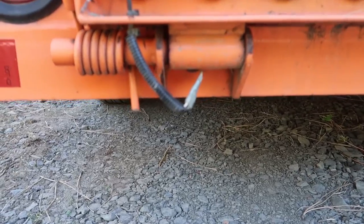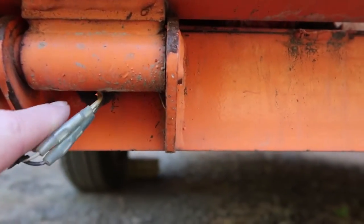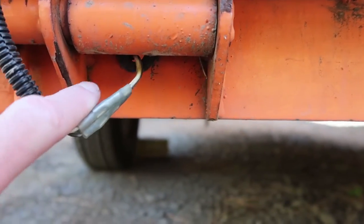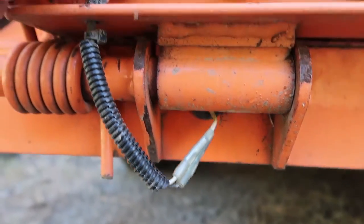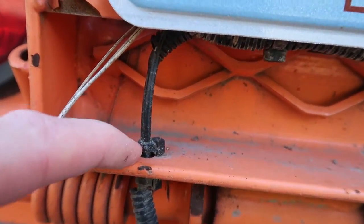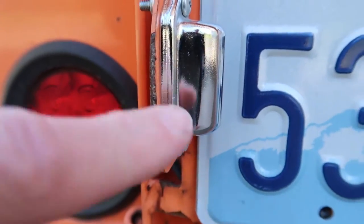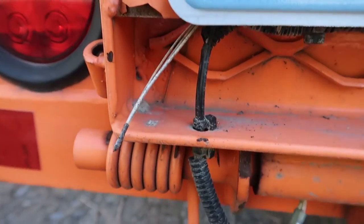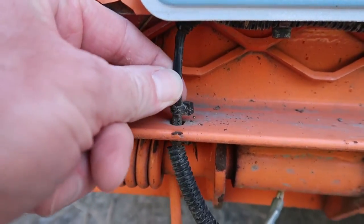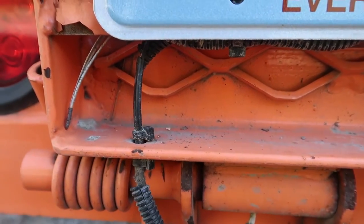And number five is how they've got the license plate light wired up. There's a little tiny hole back here through the frame, the wire goes through the frame — there's actually a little rubber grommet there — then it comes down and goes up through another little tiny hole. I've actually replaced that license plate light. The original one was all bashed up and I put some heat shrink around that wire where it goes down through this hole. Then I put two little zip ties to hold that in place so the wire doesn't have a tendency to move up and down and chafe through that heat shrink.